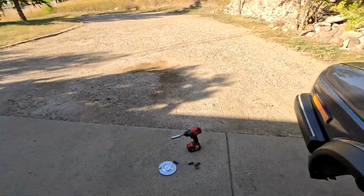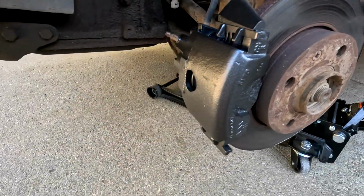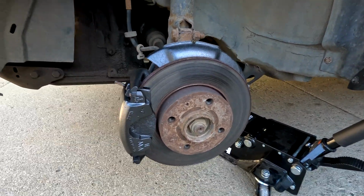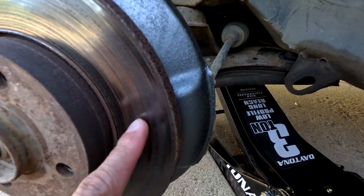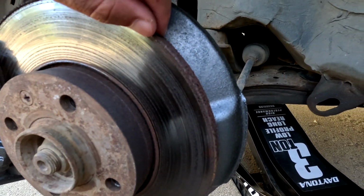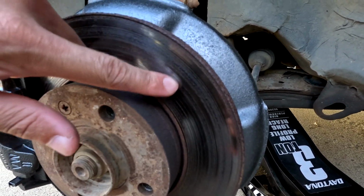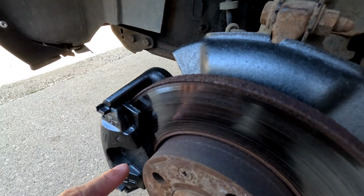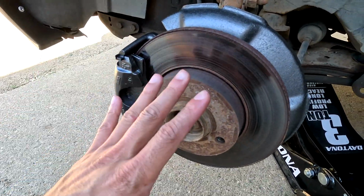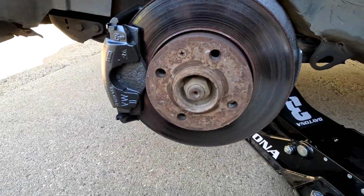If you take a look over here, we can see, well, first off, our beautiful brake calipers with matching dust cover. Love all of that. And what you also see is how beat up these poor rotors are. Crusty on top with a huge lip right here, and the face has tons of heat spots on it. The pad itself actually still has a little bit of meat left, so it still worked, not as bad as the Passat was, but obviously this isn't great.